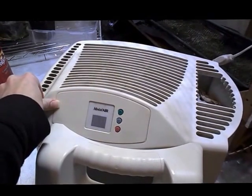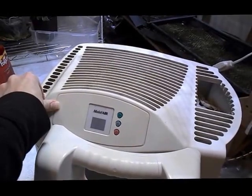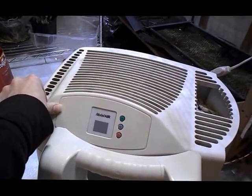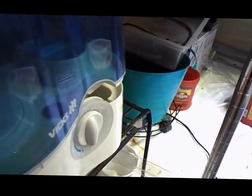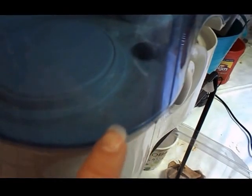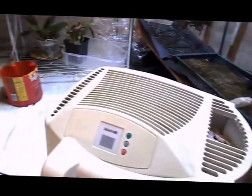I feel like everybody likes the ultrasonic humidifiers because they are pretty cool — you can get a nice cloudy mist. I had a little grow room with one cool mist humidifier on high all the time and it would get literally cloudy in there, which was pretty neat. But it's not really needed — it doesn't give you any air movement, it can leave deposits, you have to replace the demineralization cartridges which are pretty expensive. And if you want to clean them out, I've got some algae growth around that circular part that is so hard to wash out.